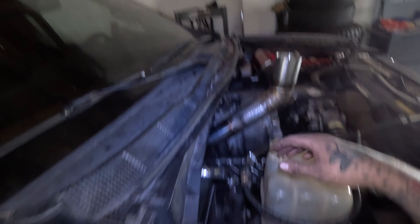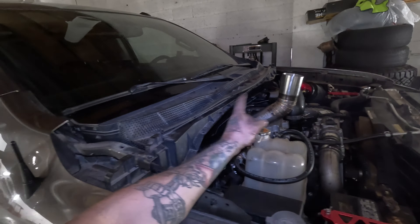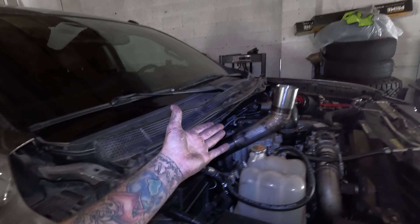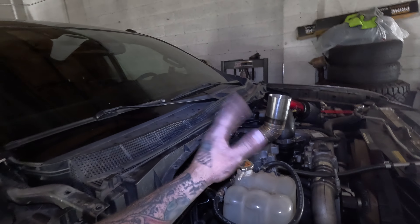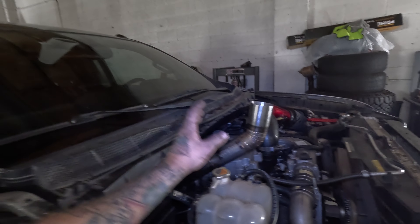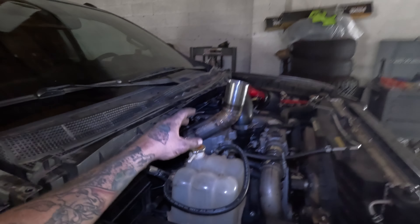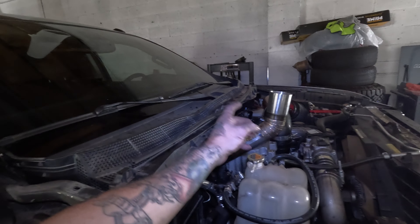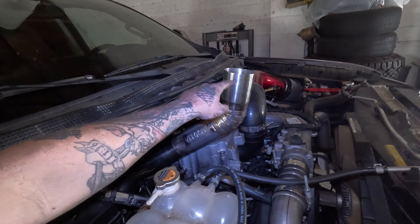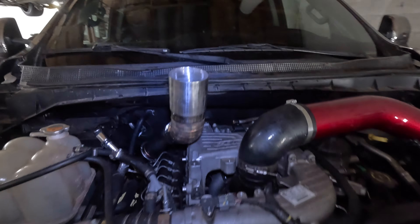Should be finished buttoning everything up — got the hose back on, bolts down tight, so that's what we're looking like. It leans a little bit forward, which was partly intentional: it's a diesel, it's going to soot all over the windshield, so I figured leaning it forward a little would help counteract some of that, cutting down on the contaminants hitting the windshield immediately. I'll tell the guy if he wants it straightened completely we can do that — probably cut the hood first. If he absolutely hates the forward incline I'll come back in the morning and cut it level.